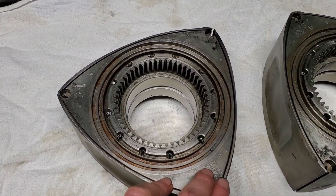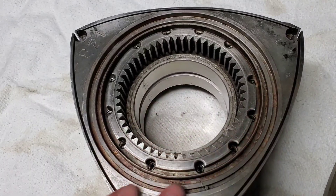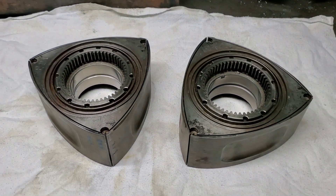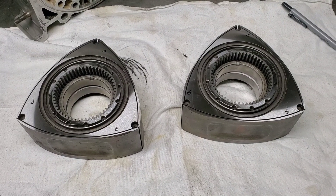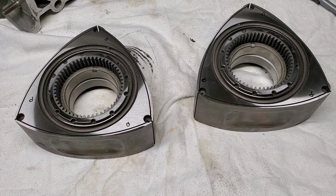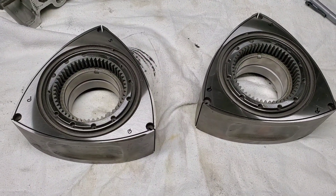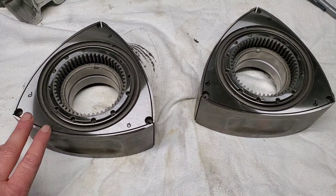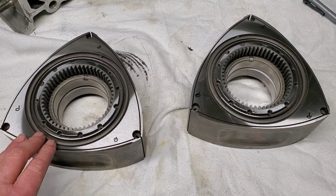As you can see, my rotors were still factory. I was trying to decide whether we wanted to lighten and side cut, or just side cut — I ended up with just side cutting for this application. Here we have the rotors back from Mazda Tricks where I was able to side cut them. This is the Mazda Tricks side cutting service that I use on basically all of my 20B race motors, Mazda Tricks race motors, and when I was the Mazda Tricks engine builder we developed this.